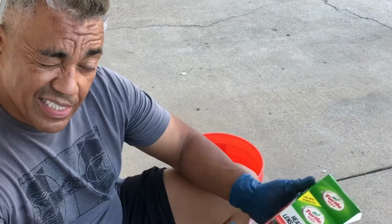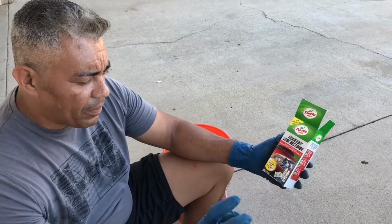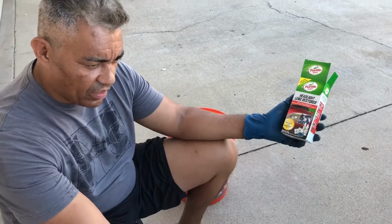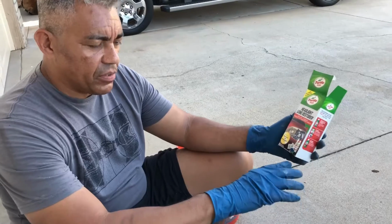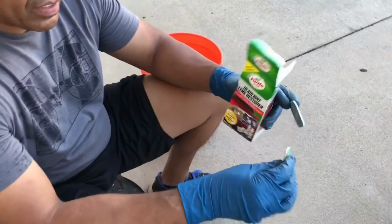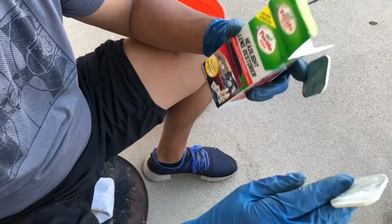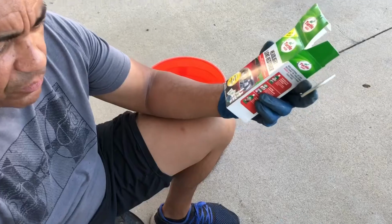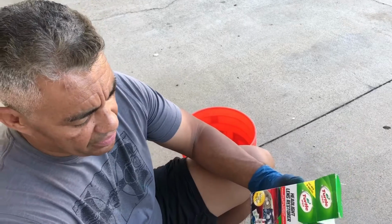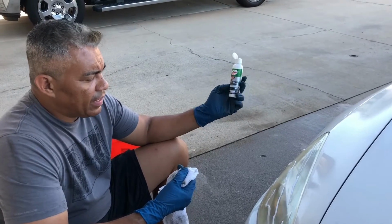It's really a 4-step process. First, you wash the lens with just soap and water, and then you apply a compound to get all of the surface scratches and all the dullness off the lens. And then you go into a polisher, which is like a lubricant. And you basically sand using these little sandpapers, right? They're just different abrasiveness, starting from like, I don't know, 220 to like 600 grit. And then you sand away, and you come back with the polisher again, and then you dry off.